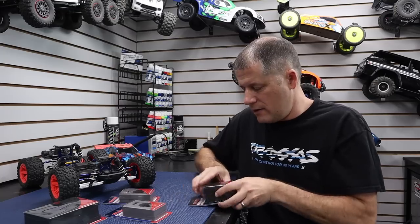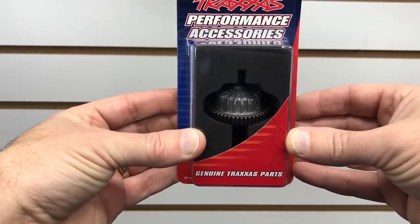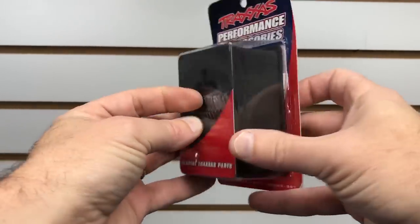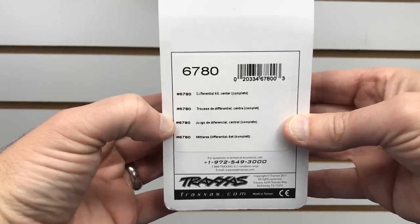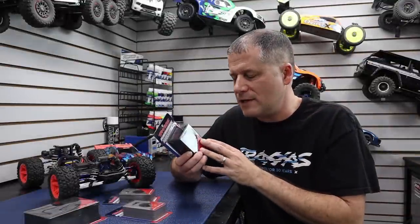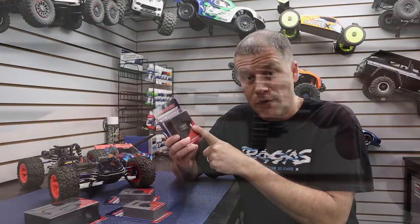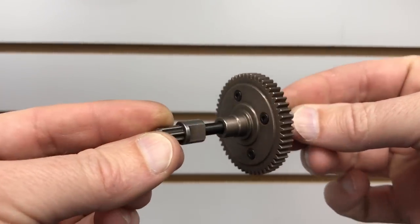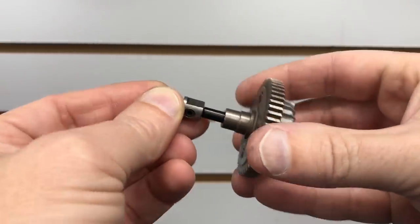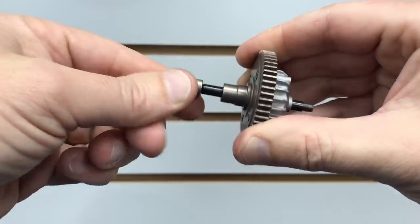Finally, what I have here — and I had to open it because I had to check this out — is the center differential. This is a pretty cool item to have. If you're going to hit the track, if you're just bashing, maybe the stock slipper is the best route. But if you think you're going to hit up the track for some laps, or you really want to get the most performance out of your vehicle, you might want to check out this center diff option. It comes pre-built from the factory with a cast metal diff cup, a steel gear, and it's already filled — you don't even have to put oil in it. It's a sealed differential with a really heavyweight oil in there. So if you want to get some performance tuning out of your Rustler 4x4, this is something you're going to want to check out.